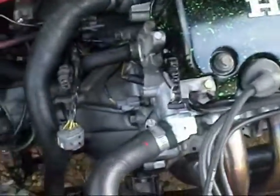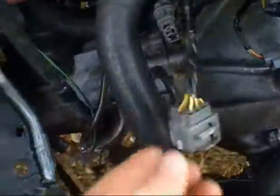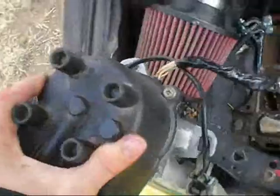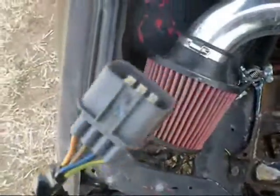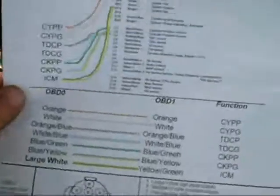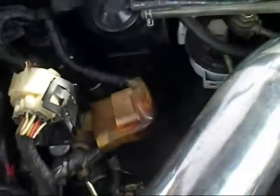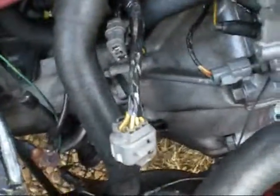So remember how I told you guys I was going to do the OBD1 distributor plug adapter on an OBD0 harness to save a little bit of money for the OBD1 swap? This is the OBD0 distributor attached with the OBD1 harness. And here's the car side harness. I color matched it with the sheet that I made that I showed you in the last clip. I can put the link or get you a picture of this if you need help with it — I made that myself, you're not going to find that anywhere else.